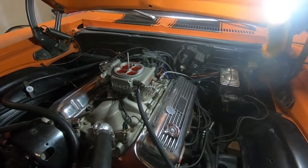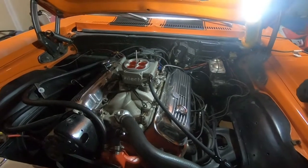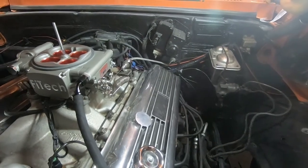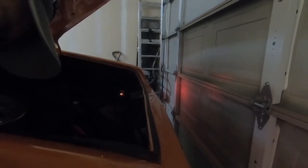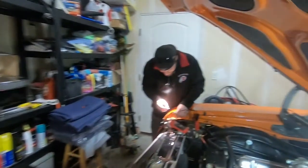We're knocking off all the little stuff. We're gonna take a look at these bulbs - in a car this old they look like original screws so we'll be careful pulling them out. We've got a messed up tail light and a front turn signal marker light. What we've got going on here is the side marker is on but we need to get a good ground. We actually have taillights, brake lights, and the far side marker light working. I think we're a night or two away from hitting the street - maybe less.